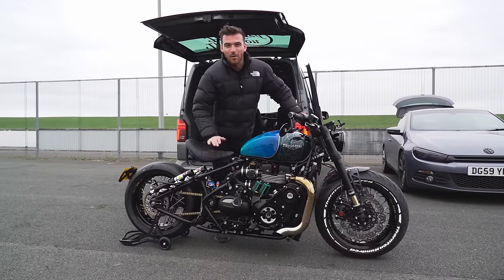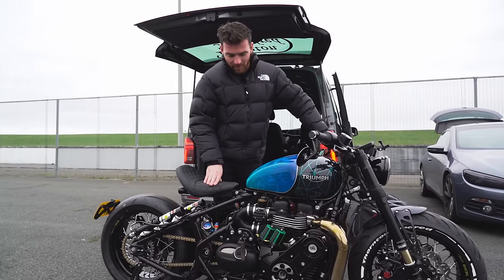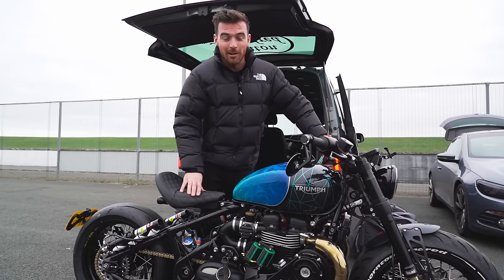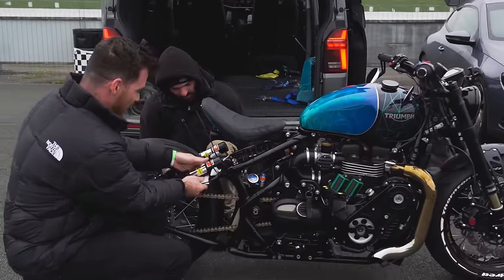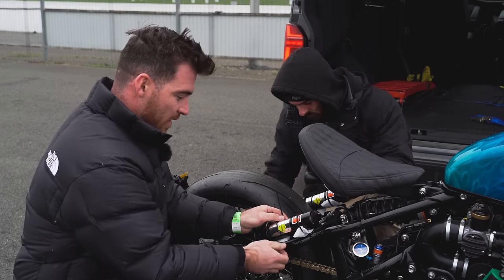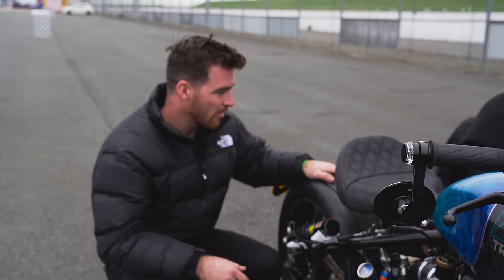In case you didn't see the last episode, we came to the drag strip and didn't do that great — we ran a 10.68 second with the nitrous, but I don't believe we were fueling correctly and the nitrous bottle pressure was also too low. So what we've done is gone to the shop, bought a load of hand warmers, and we're cable tying them to the bottle to hopefully get more heat into it, secure a better time, and not have the fueling issues from low nitrous pressure. Then we jump on this and hopefully run nine seconds straight out of the box — what do you reckon?